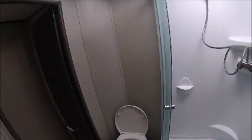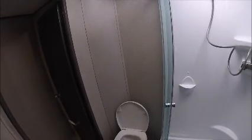With the toilet system in general, I highly recommend using RV toilet paper, number one, and some sort of holding tank treatment. Before, I showed you the monitor system that tells you the levels in the tank. It's very common for the black tank or the toilet tank to read improperly. It'll say that there's a third or 2/3 of a tank when the tank's actually empty. The way the system works is there are probes in the tank, and if anything touches that probe, it thinks that's where the level is. By using proper toilet paper and chemical, it helps keep stuff from getting stuck in the tank and giving you an improper reading.